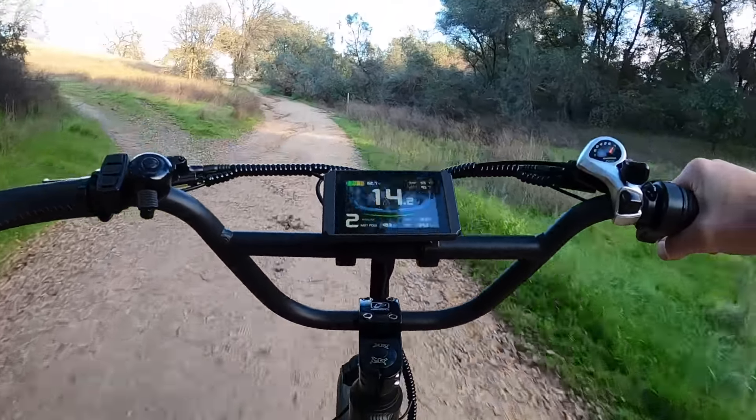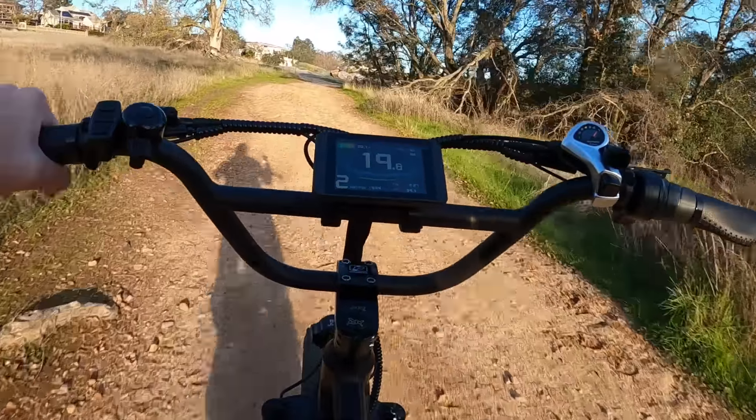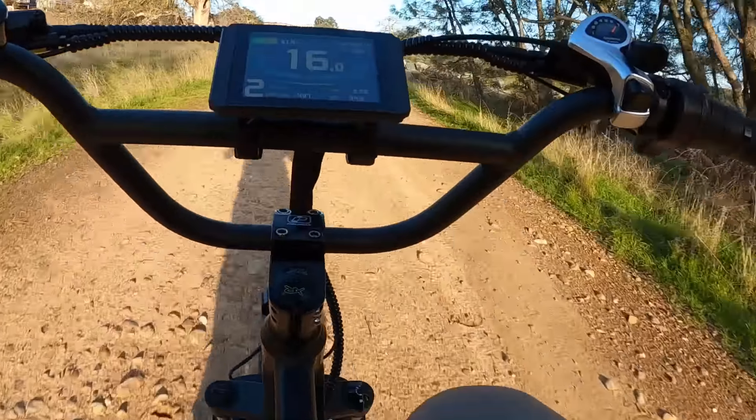Listen to that — no noise over these bumps. So it's not the rear rack that is the problem, folks, it is that rear fender. It could have been a little bit of the front fender, but I really think it's that rear fender and how it attaches to the rear rack. There are two metal washers, one on each side, and I think those should be rubber. If those were rubber, it probably wouldn't make that noise. It would probably wear out over time, but I'd rather have no noise and replace that washer every once in a while than have that constant rattling.